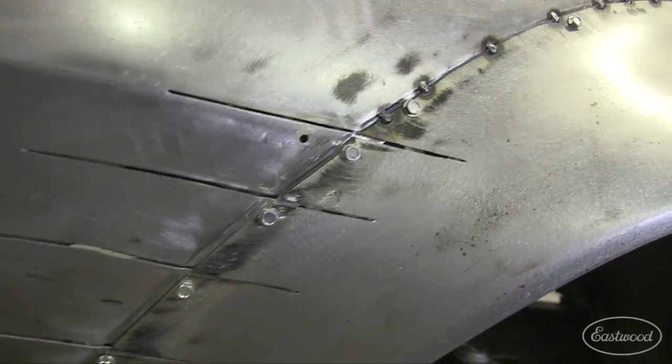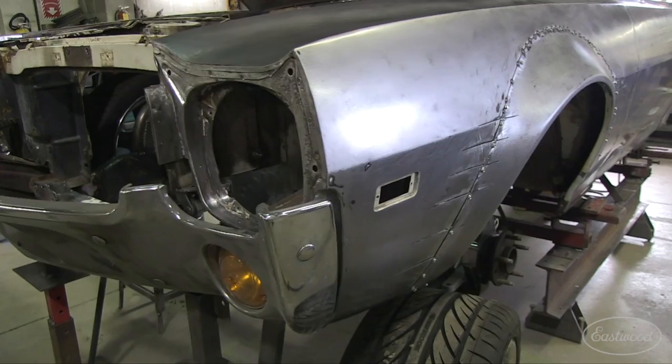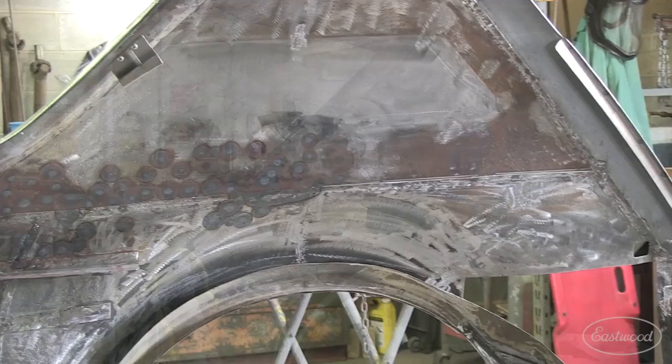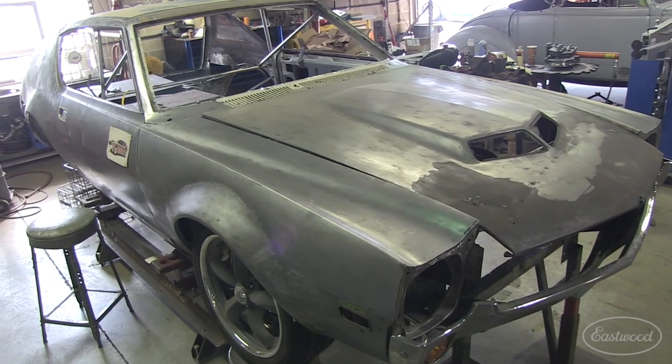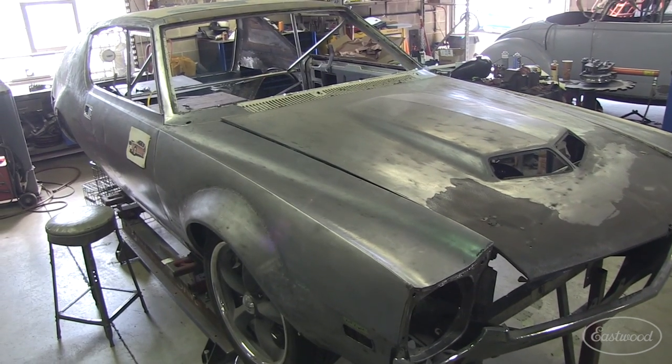The rest of the body is being hand-built from sheet metal with English wheeling and all other fabrication. It's fascinating to see it at this stage — you can see the ideas happening and how they're recreating things. The relief cuts and design draw from the original vehicles so it doesn't look out of place. The flow has to look like the manufacturer intended — it can't look like a car salad. It's the subtle things people don't notice that make a great car. They're working from archival photographs from the auto show; there were never any interior shots, only exterior. They'd like to get it done by end of year and potentially take it to Detroit for the auto show.